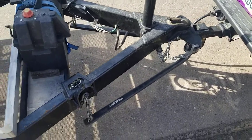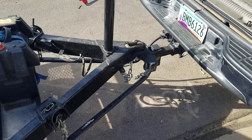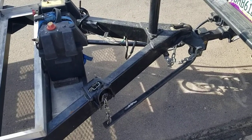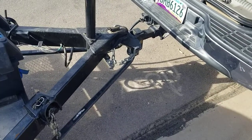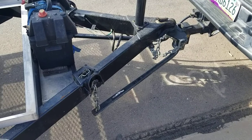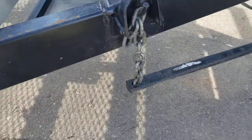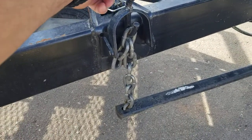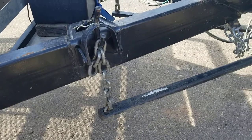What I do to make my life a lot easier when hooking the trailer up is first I hook up the hitch without the bars. Then I crank the trailer up, which since it's connected to the truck, lifts the rear end of the truck. That allows me, without too much difficulty, to pull the cotter pin and swing down these things that kind of look like horseshoes. Then I attach the third chain.